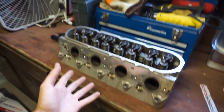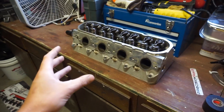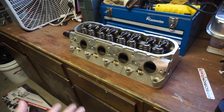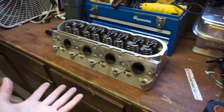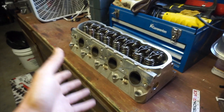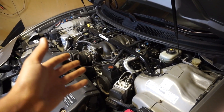After a little bit of research, the 243s are a really good option for me. They're the same casting as the 799 cylinder heads, but I believe the 799s castings are just a little bit worse than the 243 — so they could be cleaned up a little bit, but physically they're the same. If someone has anything to comment on that, drop a comment down below. I think that's the only difference between the 243s and the 799s. Anyway, this other cylinder head will really round out that LS6 intake manifold that I bought a while ago really well. We're replacing the 853 cylinder heads, which are some of the least desirable heads on this LS1 engine. It should really bring the combo over the 400 wheel horsepower mark, which I'm really hoping it's gonna do.